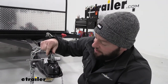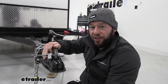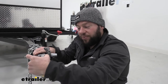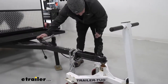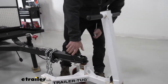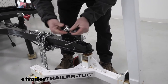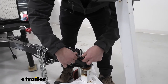You're going to need that adjustment because not every latch is the same — most of them around this size get a little bit bigger. But you can also use this on different style trailers, like a trailer that has a brake actuator. It's going to be a little bigger and maybe the latch goes through the body of the coupler, so you'll be able to use this on those bigger widths. Now, I mentioned you can use it when it's attached to the ball. We have our cart here to simulate a vehicle being backed up to the trailer and lower the ball down on top of it. That's lowered into place — I can throw that latch and then put the pin back through. See where it lines up on one of the adjustment points right there.